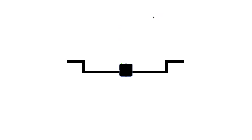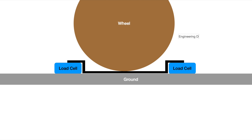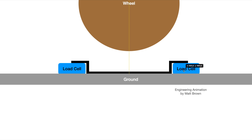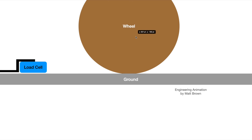All I need to do is get scales underneath each wheel without moving the wheel up too high and messing up the weights. I drew up a platform with four scales and a lower center. This way I could jack up one corner of the car, slide the scale under the tire, lower the jack, and read the weight. But then I have to jack up every corner of the car, slide this thing under, drop the car, jack it back up, remove it, let the car back down, move to the next wheel, and do that four times. What if I made something that jacked up the corner and weighed it at the same time?